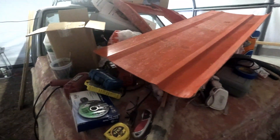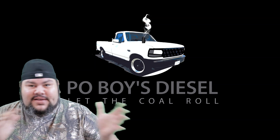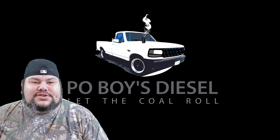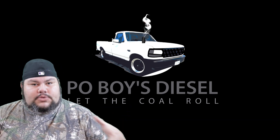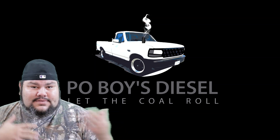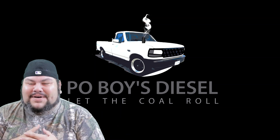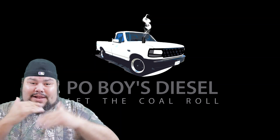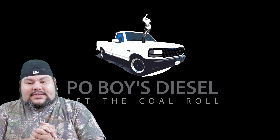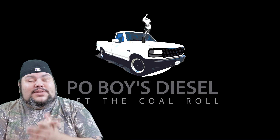All right co-rollers, we're back inside, all cleaned up feeling fresh and good. As you guys were able to see, we put a little bit of construction and a little bit of truck work in this video. Two days ago we built that rack so we could keep the roll of fiberglass mat off of the ground and make it more versatile to work with — especially since I'm usually working alone or mama po is there giving me a hand, and I'm not gonna make her lift that stuff. Then today we continued working with the tailgate — went ahead and trimmed all the excess, grinded all the edges to make them nice and smooth and parallel to the part, and we separated the mold.